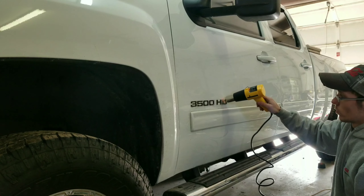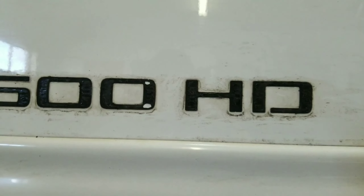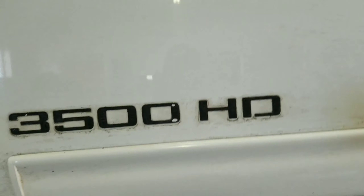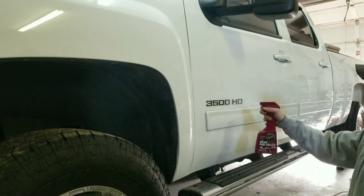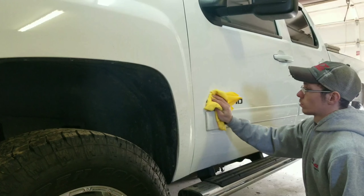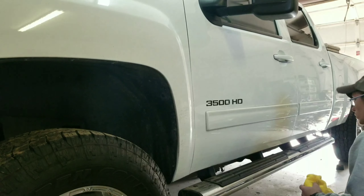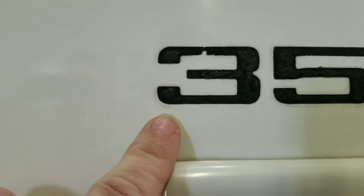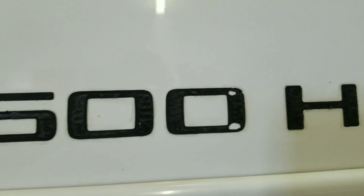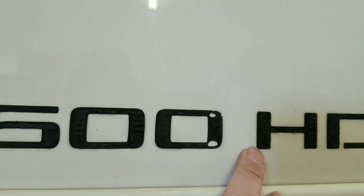The first emblem is removed, and as you can tell, there's a lot of garbage and gunk behind it. This is where you're going to want to take your quick detailer and microfiber towel and just clean it up a bit. It's still going to have a little bit left over — you won't get all of it out, but you'll get a majority. You don't want to have a ton of it left when you go to use your eraser wheel, because it can actually embed the dirt and grime into your paint, which is harder to get out.